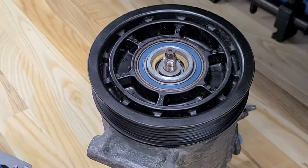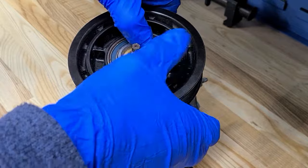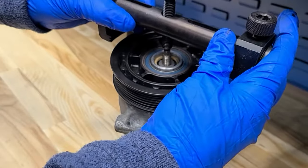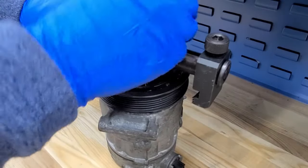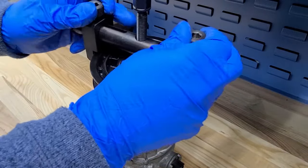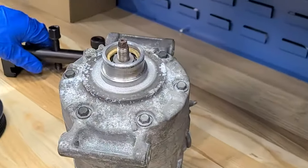If this bearing is still good and the inner race hasn't seized and the inner race hasn't spun on the nose, you can just slip this off — this bearing is a slip fit. If the bearing is partially seized and has spun on the nose, it's sort of worn itself a groove or welded itself, and you're going to need a puller. This kind of rib puller is really fantastic — I sell these, you can also get them lots of places. It's that easy, and then you've got a jackscrew that you can turn to pull this pulley off. This will probably break the pulley if that bearing is really stuck on there.